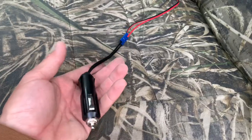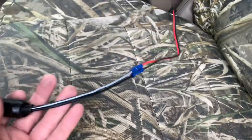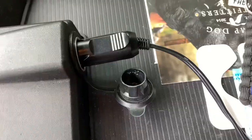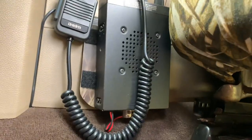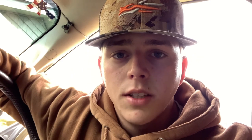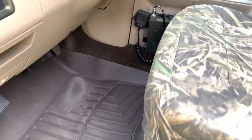Oftentimes people will hardwire a CB into their vehicle, but I just don't like that — if you want to swap your CB you have to undo wires and it's a mess. I just wired it to a cigarette plug and plug it in. The most convenient plug was right here in the console. I ran the wire down behind the plastic and it comes out into the CB — I got the Uniden 510 XL, it's pretty small, pretty sleek, hides very well in the truck.